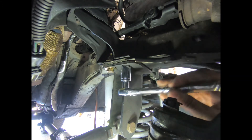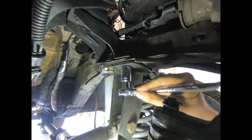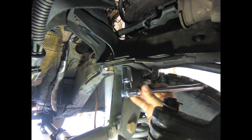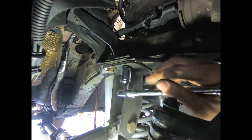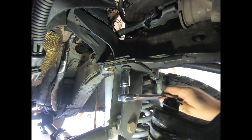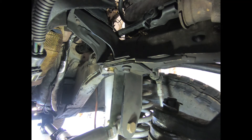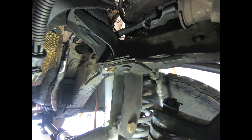When I checked on this last time, all four bolts were loose, which I think is the reason why that last bolt sheared off in the first place — plus a few years of bump steering and death wobble. I did fix the death wobble but never fixed the bolt until today. The cause of my death wobble was that the track bar was off angle, not lining up with the drag link. I bought a kit with this bracket and the track bar, but the ball joint on the track bar wore out over time, and my lift has gotten higher over the years so that track bar wasn't going to work anymore. I had a custom one made but I kept the bracket — it's still good, and I might end up welding it to the frame sometime in the future.